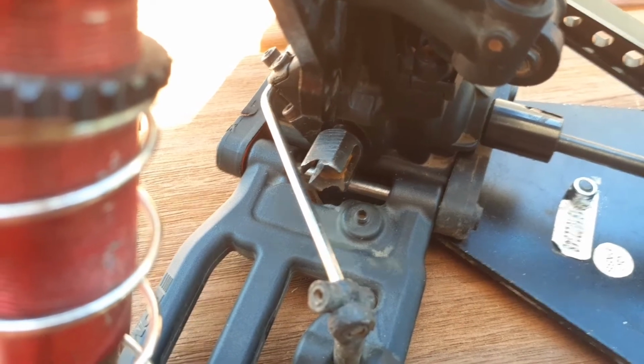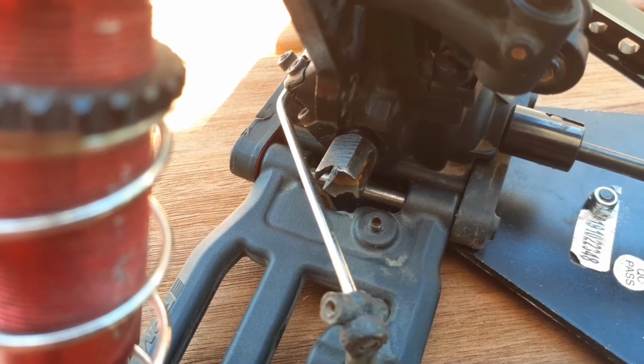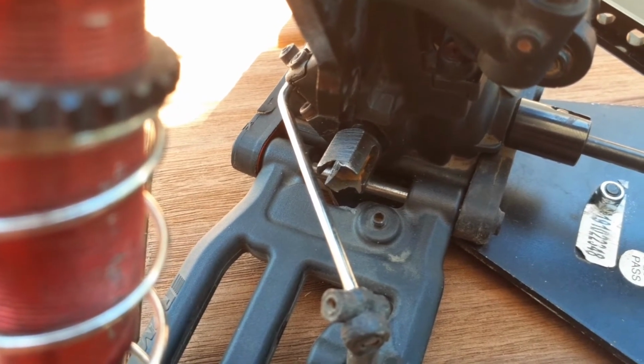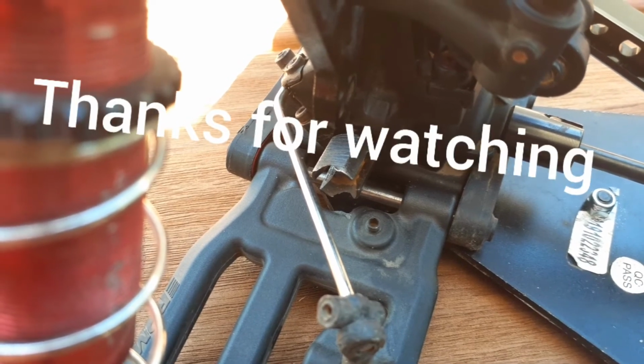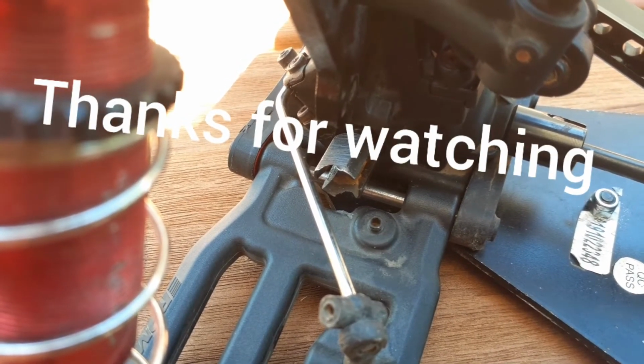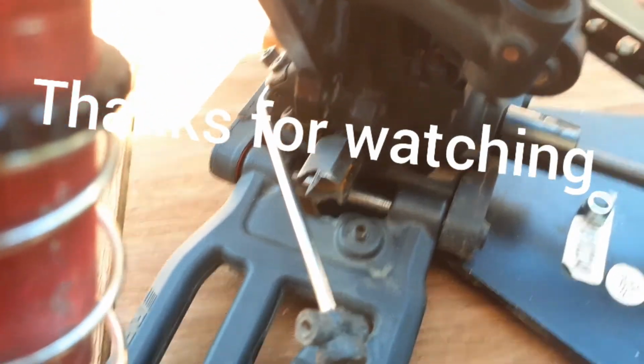So I don't know if the bearings were maybe a slightly different size. I mean, just off by a hair, and that caused a problem. But it's been rebuilt with new bearings in there also, and that new ring gear. And like I say, it's smooth as butter in there right now after doing that.